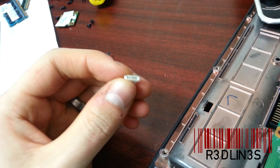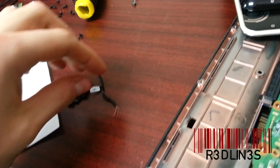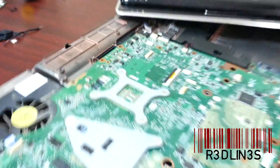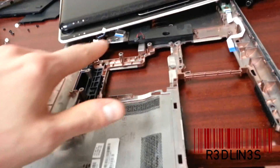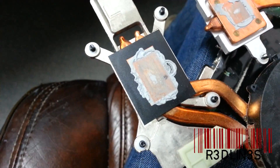I figured out what the problem was. It looks like it overheated and melted the wires out of a connector here for the Bluetooth — look at those wires, ridiculous. That shorted out. So we're getting at the CPU area, removing the casing and looking at the motherboard. We take those screws out and get the heat sink off — you can see a burn mark right there.